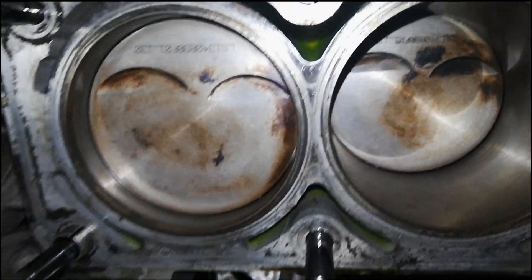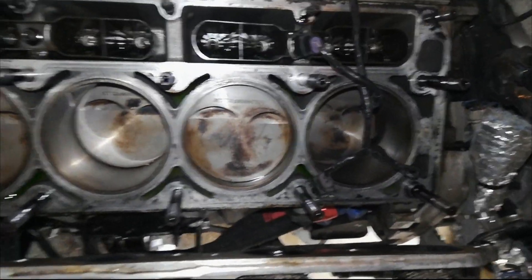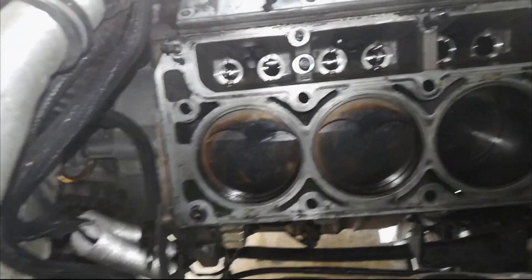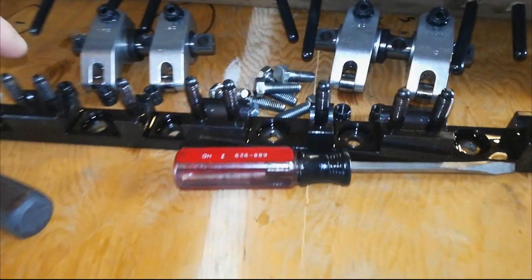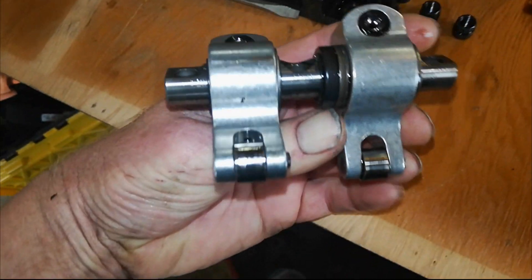This is what it looks like after cleaning up a little bit — just a rag wiping it out. Nice set of inch-and-five-eighths headers, custom made. I got pretty lucky — this side came right off. The other side, most of the studs were coming out, so I guessed they had to come out, and that's how they got it out the last time they did this job. I pulled out the long ARP studs on the bottom and left the top ones in — they were not going to be a problem. Here's what the rocker arms look like — it's a T&D shaft rocker system, very nice design — and they look really good.